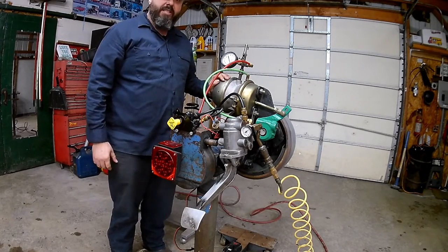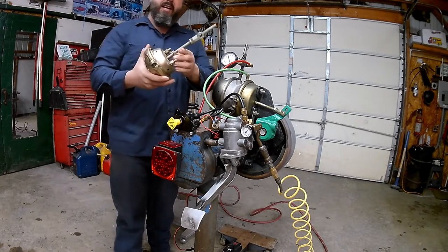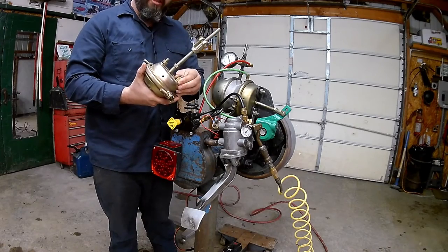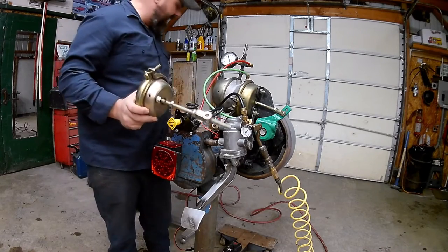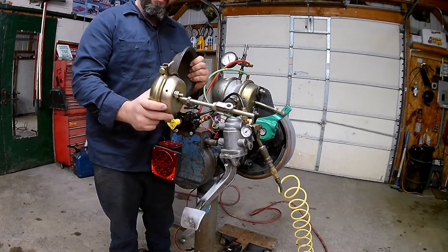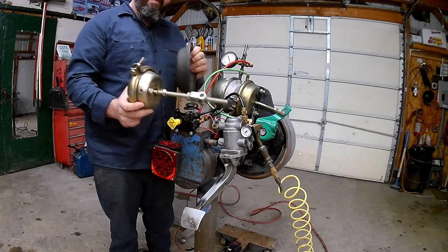There are two different types of brake chambers. One is just a simple service brake chamber, found more on steer axles and drop axles that are steerable. It just has that diaphragm in one part. This is only activated when we step on our brake pedal — air goes in, pushing out this rod.